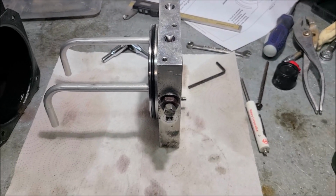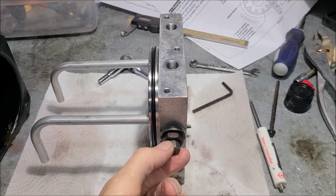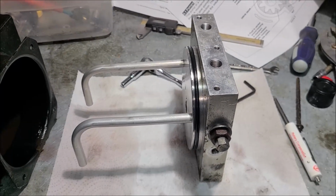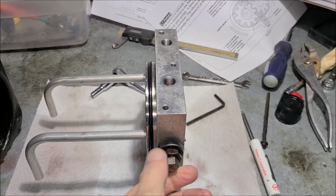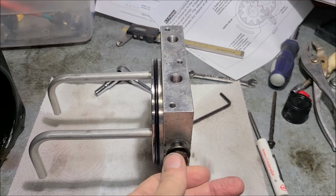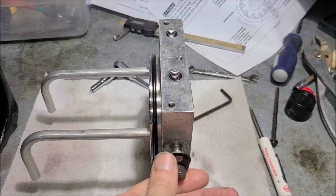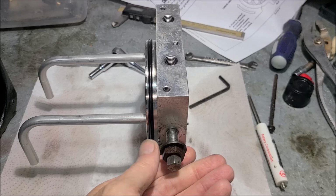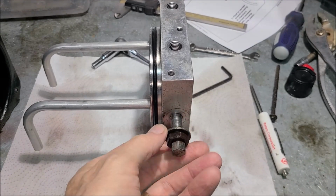All right, let's readdress this pressure valve, the spring and ball here. Say, for instance, you've already screwed up and you've backed this all the way out and possibly took it out. When you did that, you noticed you got a spring, but you don't see a ball. Well, where'd the ball go? It's dropped down into this little pipe.